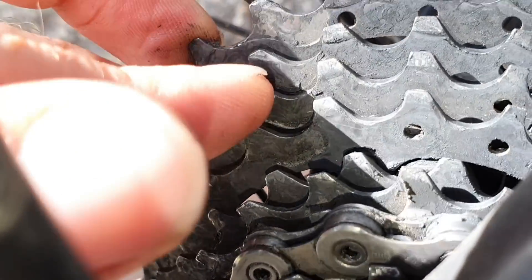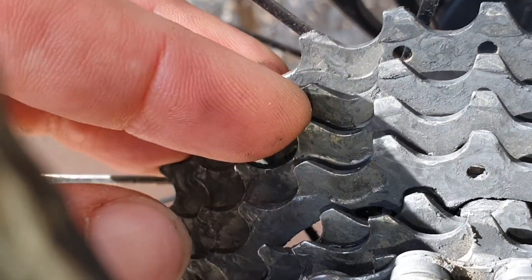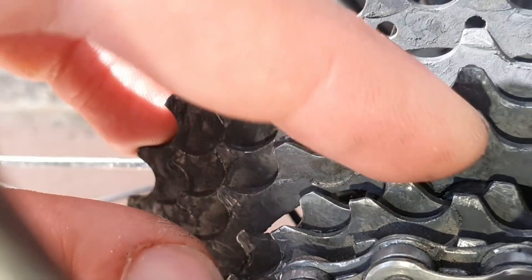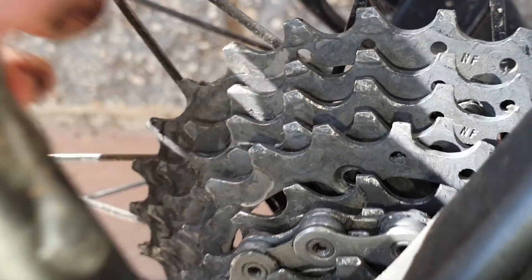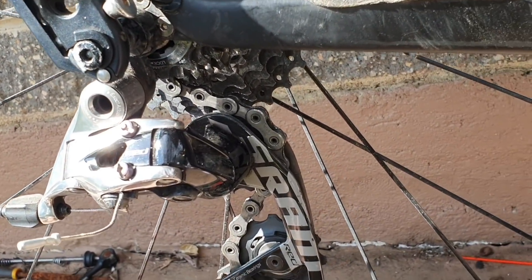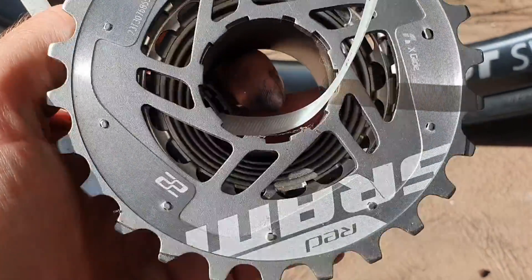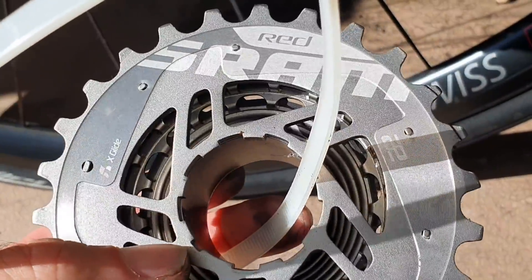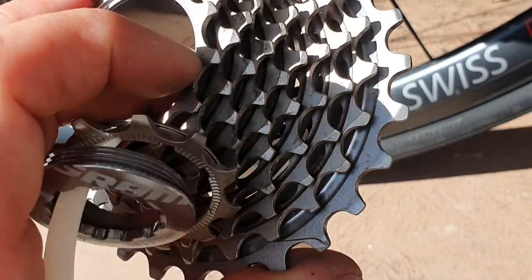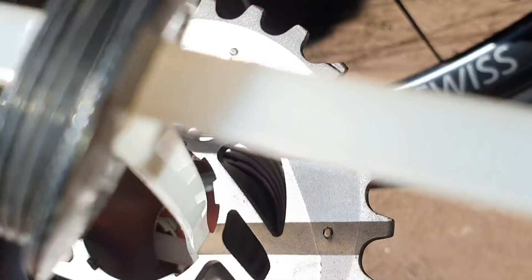So that's a side effect for me - I'm breaking stuff I never used to break. This top carrier is okay, but the fourth tooth is loose, and this one here is just flat. What we're going to do is remedy it - I'm not going to have a Shimano in there because it's just going to mess stuff up again. We have here what you want to fix it with: SRAM. SRAM makes some good stuff - same with Shimano. You can't just rule out a brand. This is an XG and I like these ones.